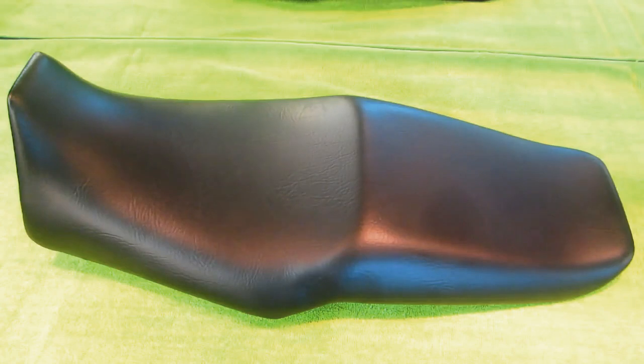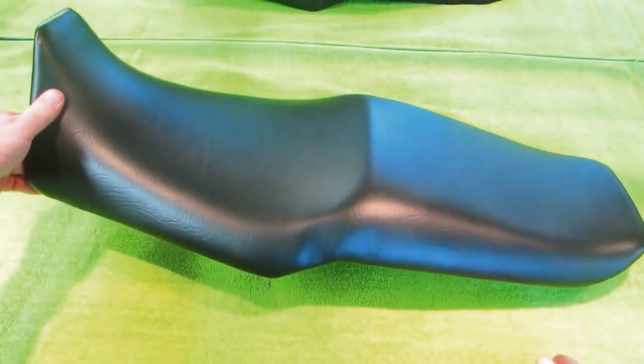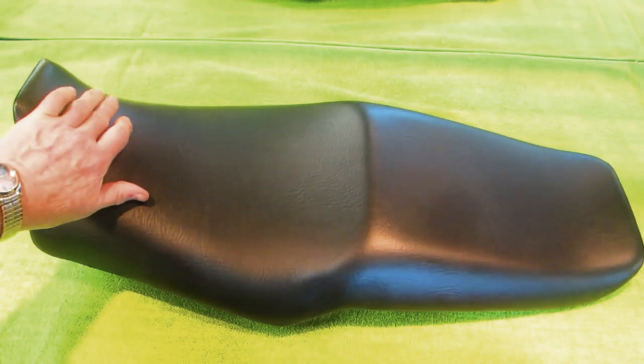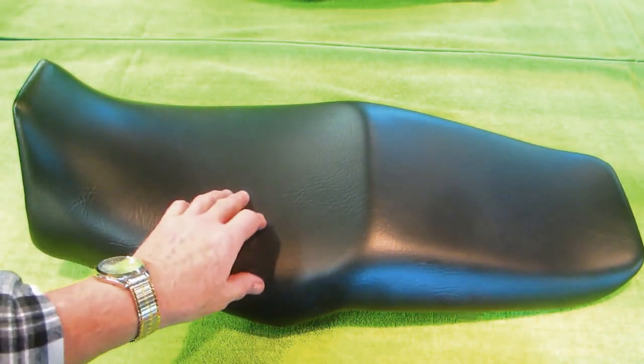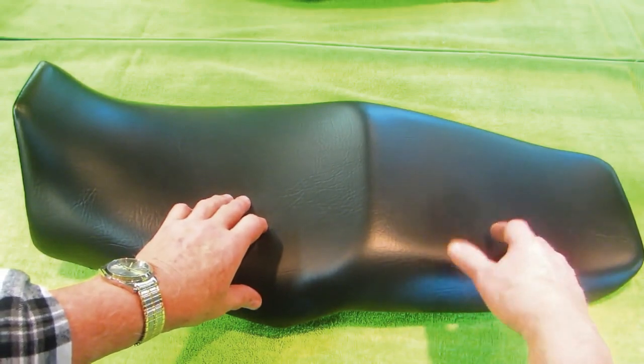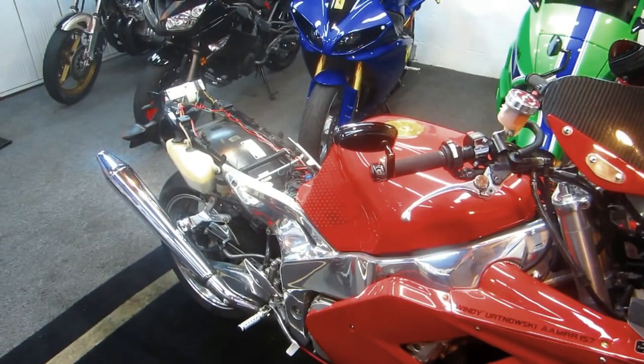Now at the end, I always think the biggest tips are use the correct staples. That saves you a lot of grief. Pulling out the wrinkles, be patient, keep moving the vinyl, and the biggest tip of all on this video, the biggest thing, where the wrinkle is, pull it in the opposite direction. It kind of makes sense when you do that.